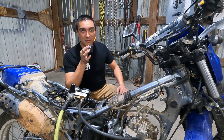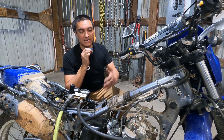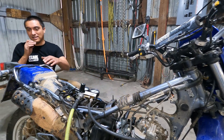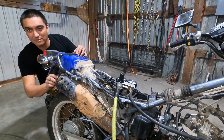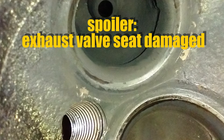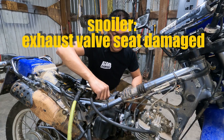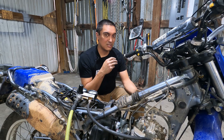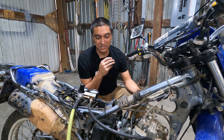I've disconnected my microphone and I'm holding it in my hand so I can show you how useful this is as a diagnostic tool. I can hear air leaking out of not only the exhaust right here, but I also hear air leaking out of the intake — and if I open the throttle you can hear a lot of air. So that means both the intake and the exhaust valves are leaking, which is not a good situation.